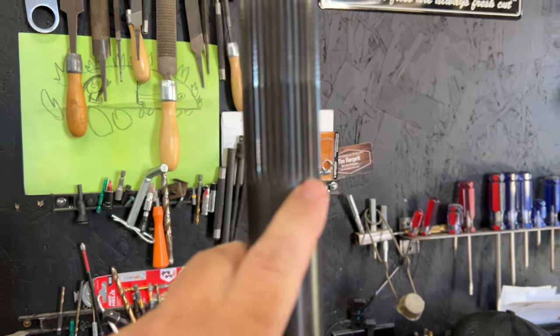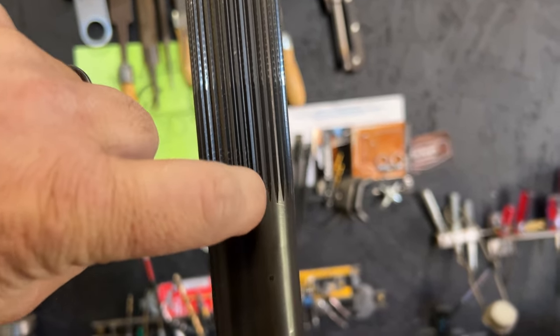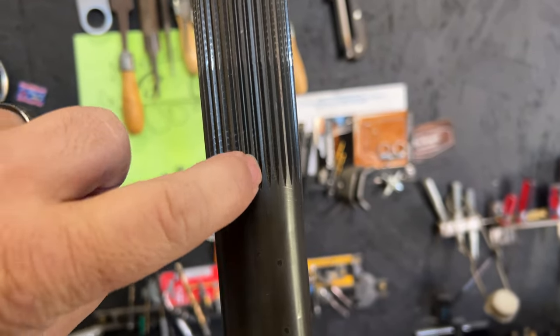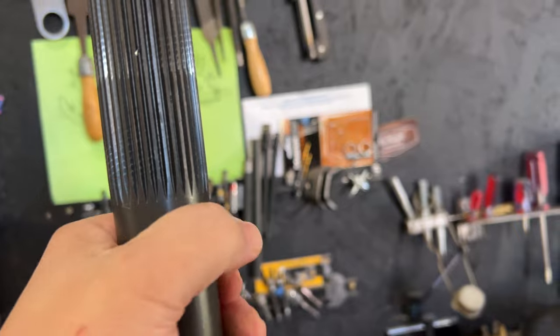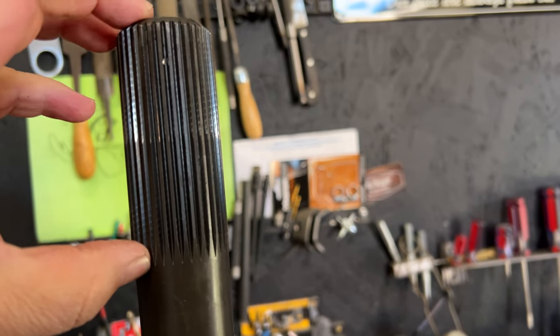So we talked about the axle, and I was having some conversations with somebody, and their suggestion was, if the axles aren't hitting in the rear end, meaning they're too close and touching inside the spool, which they are not, rather than sending this back to Quick, to take a grinder, a DA, like a death wheel, and just cut at these very ends all the way around so that this will push all the way inside the spool. And so what if it's got that much engagement into the spool? That's not gonna hurt anything. So let me know what you guys think.